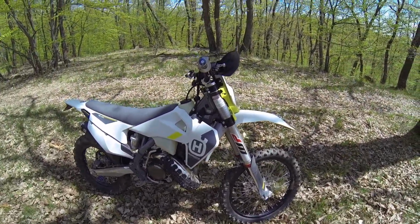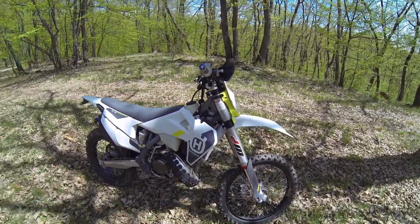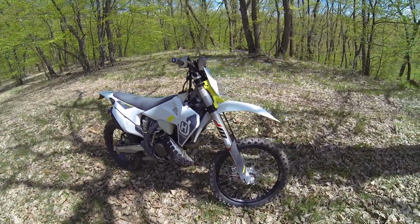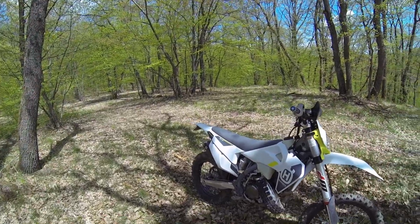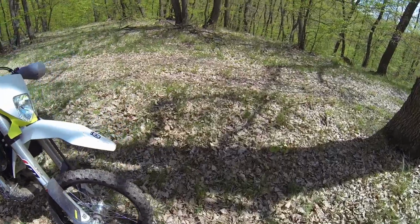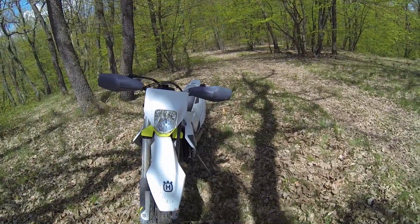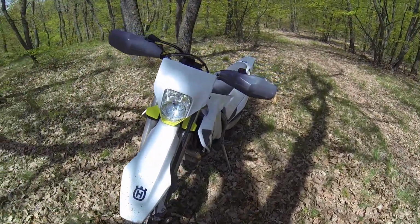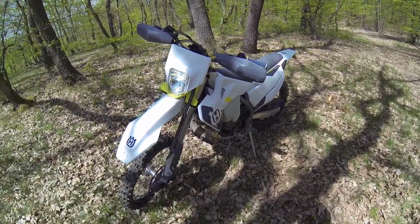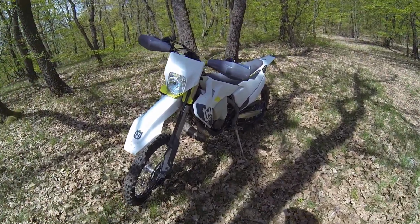And I've watched some online trainings about how you warm up this bike. I saw that most of the YouTubers say that you need to leave it running for about 4 minutes, but that just doesn't work for this one. If it's cold outside, like below 10 degrees, and I leave it running, in 3 minutes it just fouls the plug. So it gets extremely rich. It shuts down, then I need to replace the plug and start it very hard again.